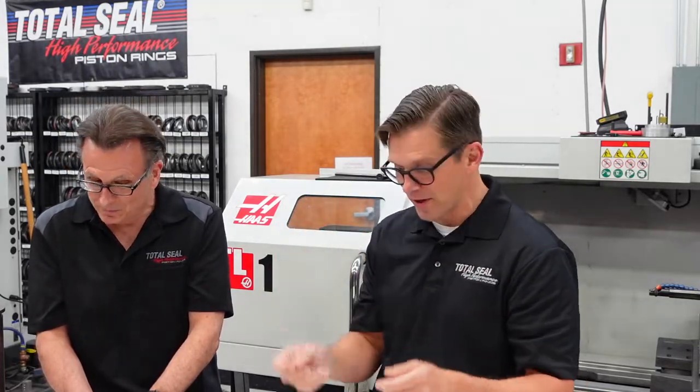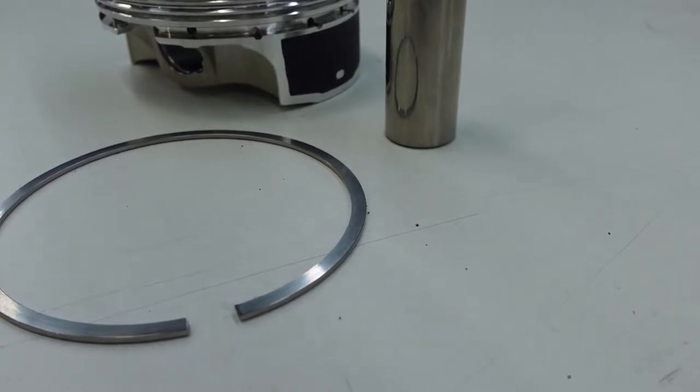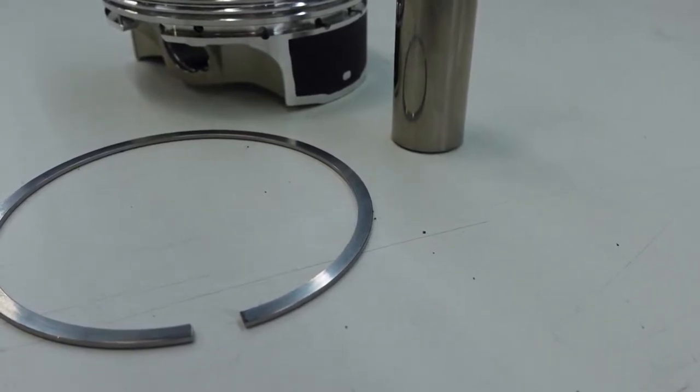And it's a great segue to the fact that the piston ring is a seal. It is not the structural component. Even if that piston's moving, no matter what thickness of the ring, bad things are going to happen. Like I said, it binds in the groove, what happens? Ring seal is out the door.